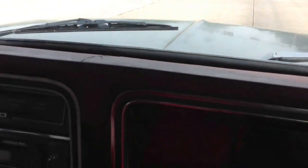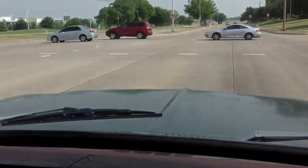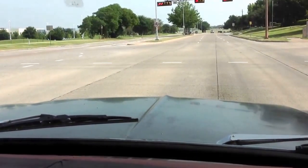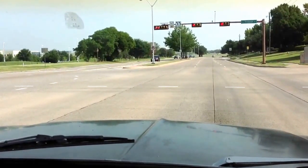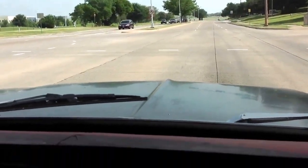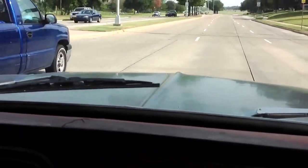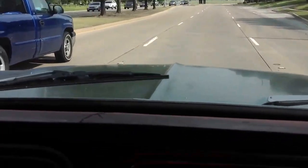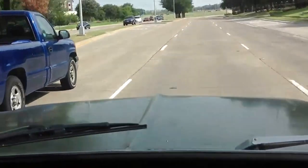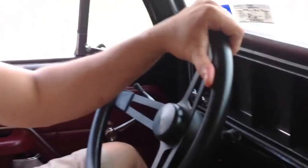That's probably good. It'll go 55 miles an hour all day long. Engine tach sounds good. I don't know what the rear end gear is. It's probably like a 3.08 because it's got a lower gear Ford 3-speed in it, but it might be a 3.31 gear ratio. It'll definitely get you around town. On the highway then, they didn't really care about gas mileage, but it gets about 8 to 12 miles per gallon. At 65 miles an hour, the RPM is probably about 3,000, maybe a little bit higher.